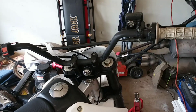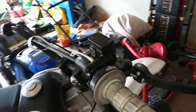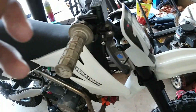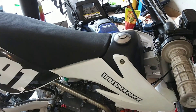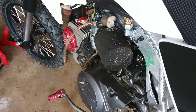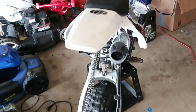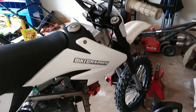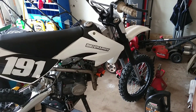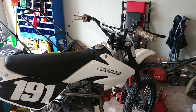I just wanted to address the fact that I haven't forgot about this one. Micah, finally the bars are not on back order, so I should have four sets of Micah metal bars on the way. It's going to get new forks, new bars. We're going to try to find another tank because that steel tank still has a little bit of rust and every now and then it's getting into the carb. I was able to put a fuel filter on here yesterday so that's kind of helping, but you can see the fuel in there is really dirty. She's solid, she runs. I rode her this morning and a lot yesterday — me and broke foot went out. She will be Apollo V2 here shortly, especially with all the time we have with this epidemic quarantine situation we have going on.